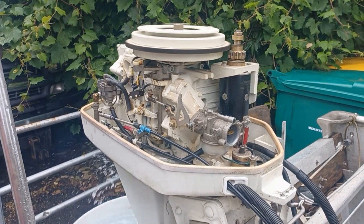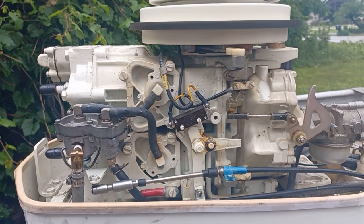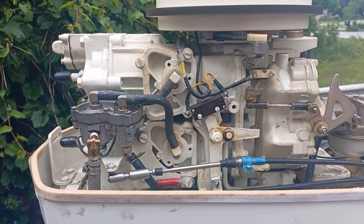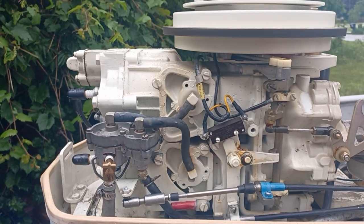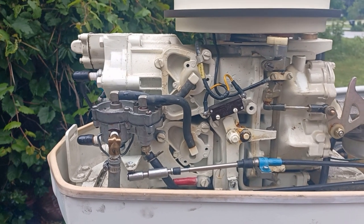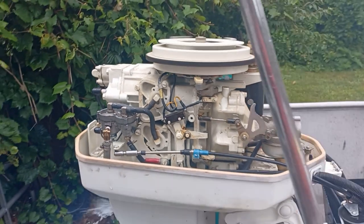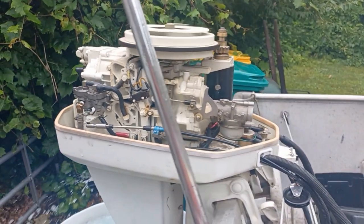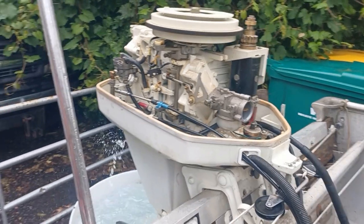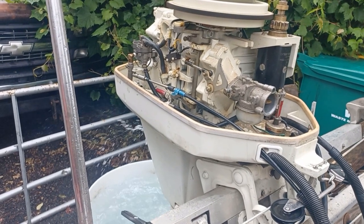It's alive! That's going to pretty much sum up this video. I appreciate you watching — I know this was a short one, but it had me stumped and I even broke down out on the lake. If you have this type of setup — it doesn't have to be this exact engine — if it has fuel lines and it sits, those fuel lines can deteriorate. In my case it looked like leaf material in there. Hopefully this gives you some insight on what to do and gets you out on the water next season. Thanks for watching and we'll catch you on the next one.